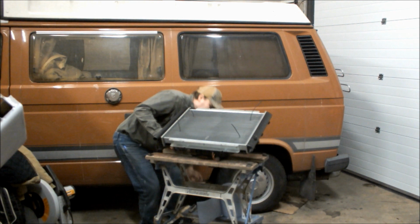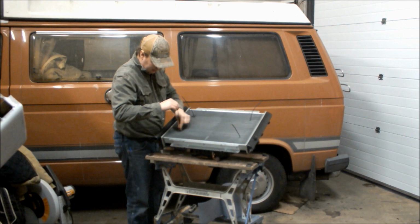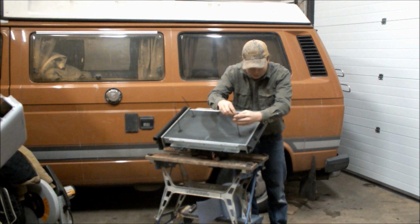So I'll put these on first. These just slide over the top. One, two, come on, two. That's just to stop the fan digging in. You'd think this would make the radiator leak, but the reality is it's probably 3 or 4 mil away from the nearest bar in the radiator, the nearest core, so I can't see it doing any real harm. And they do fasten on quite nicely, so we've got those on, four of those.